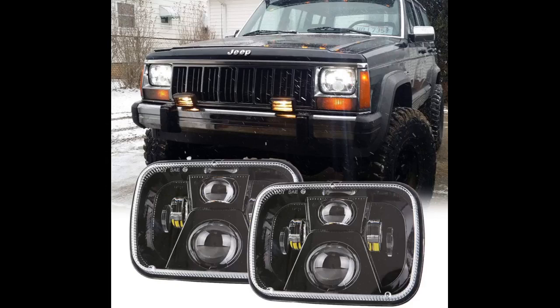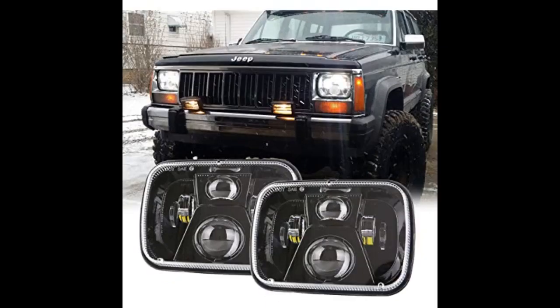Just push back the retainer with a small screwdriver and pull them out, then change sides. The fitment is snug. The old glass units had plenty of space all around and just dropped out when I removed the bezel. These fit like a glove. No sanding, no filing, no dremel. The LED housings almost hold by themselves inside the headlight assembly. The connector on the bulb creates a few inches of extra cable.